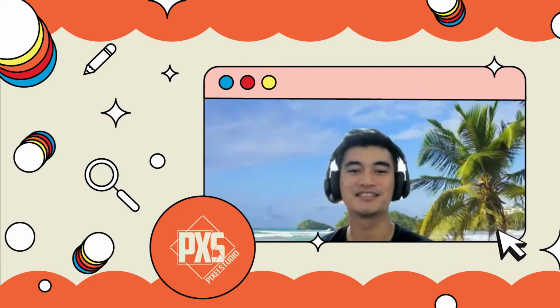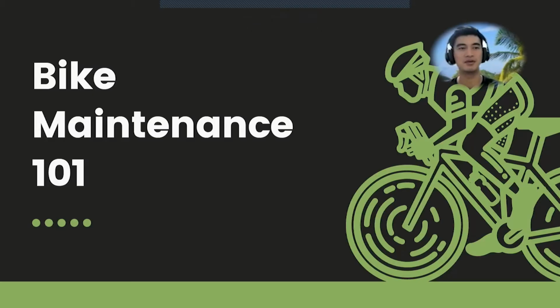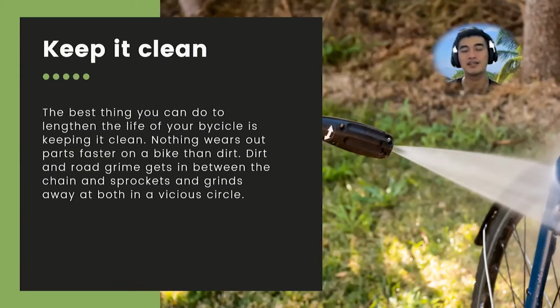Bike maintenance. Okay, today I'll be sharing about bike maintenance. The topic is to present you guys multiple ways to actually maintain your bicycle or to make it last longer. Okay, one of the ways to make your bicycle last longer is to keep it clean. That's the most essential part, especially after you mountain bikers or any road bikers out there always cycle through all the dirt and especially the dirty roads. It will collect all those grinds and it will start in between the chain and the sprockets and will grind away both in a vicious cycle.